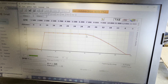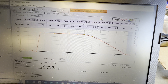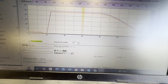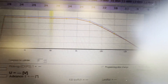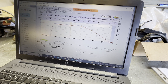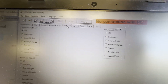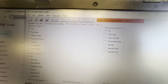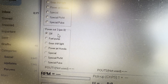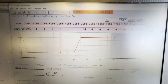On the advanced maps we run it up to 25 degrees - this is just the base setting for us. A lot of these ignitions just taper them off as the revs go up. From around seven to eight thousand we start to taper off the advance and bring it back to nearly zero. We'll fine-tune that when we actually put the bike on the dyno - that's one of the things we'll be checking for performance.